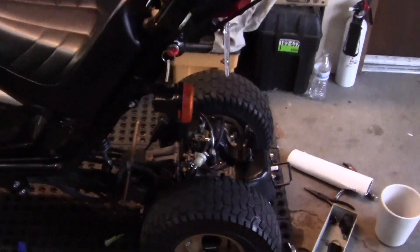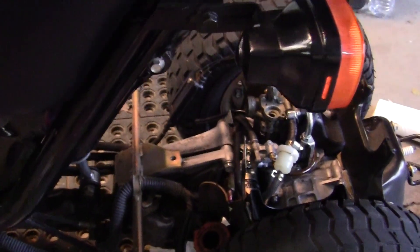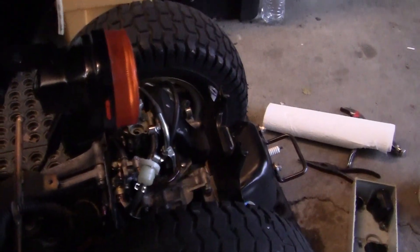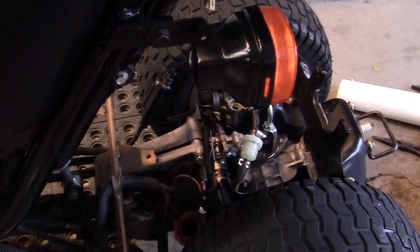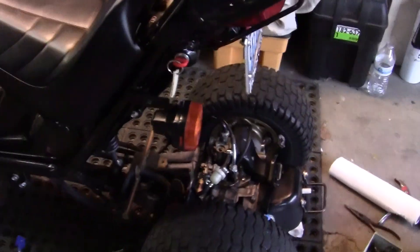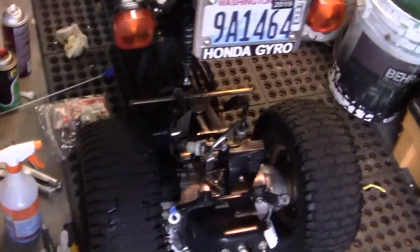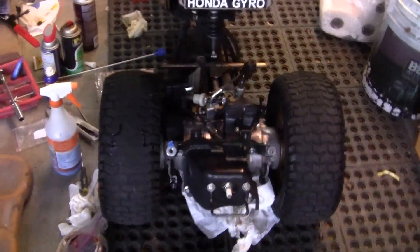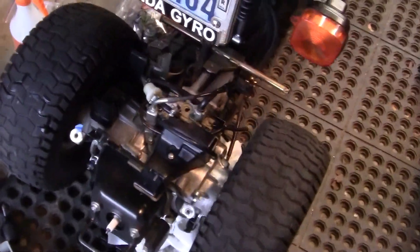The thing about the oil pump is it has a stem about six inches long. Most of these oil pumps run into your combustion gallery for two-strokes, but this one runs into the transmission gallery with a regular 40-weight oil. So it leaking a little bit wouldn't have any effect on the case integrity as far as having an air leak that would lean it out.